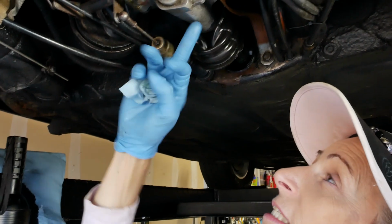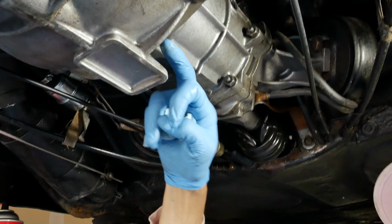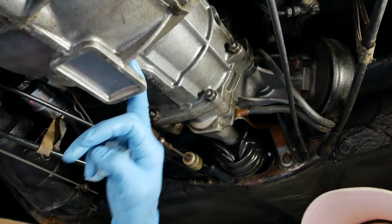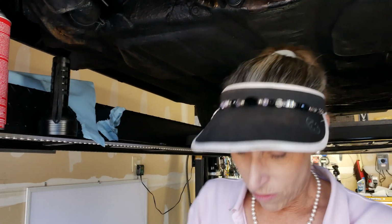So that would kind of make sense. If our shaft seal is right about this level, which is almost at the bottom of this, we might have a little bit left in the transaxle here, but that's about it. So what does that mean for the transmission? Well, it's really, really bad. It can completely destroy the transmission. Obviously, the gear oil's in there for a reason. The oil that was pouring out of this thing doesn't look bad or burned or anything, and there's no awful smell, so I think it's probably okay.